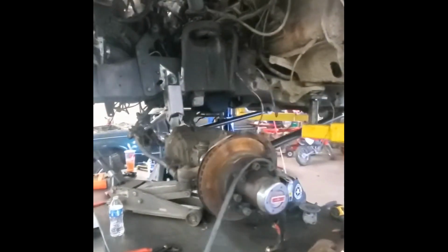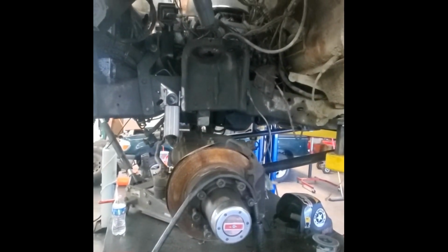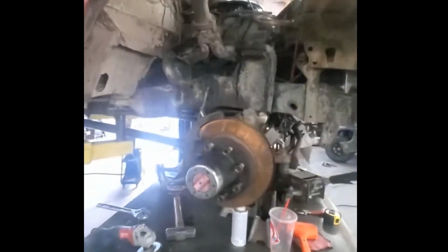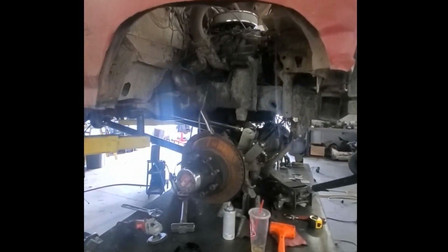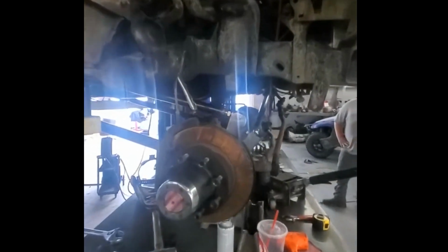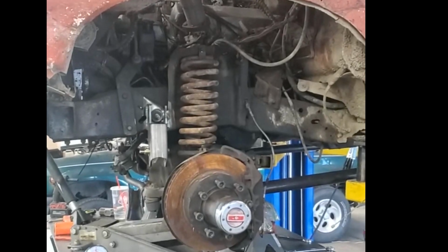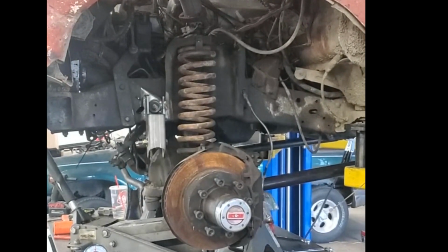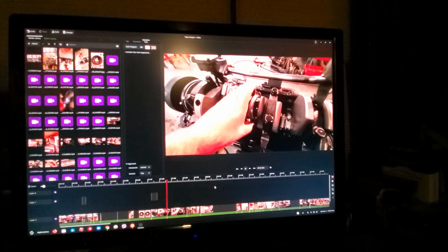All right, set her down. Look at that. Beautiful. Go ahead and lift it up about a foot. Look at that. Pinion angle didn't change. It's pretty good. We're going to see how much travel it has before that spring gets loose. All right, go ahead. Sweet. What's that, about 2 inches? There. Is it loose in here now? Yeah. I think so. Yep.